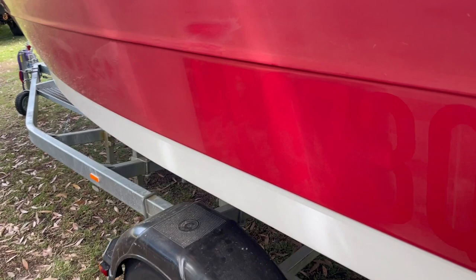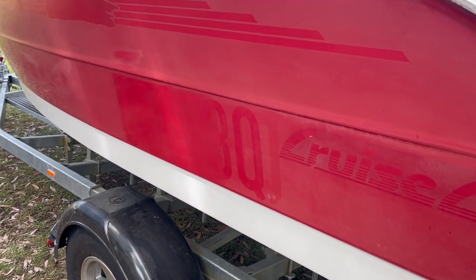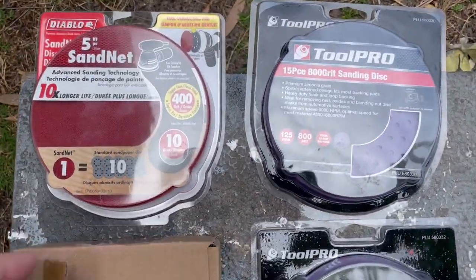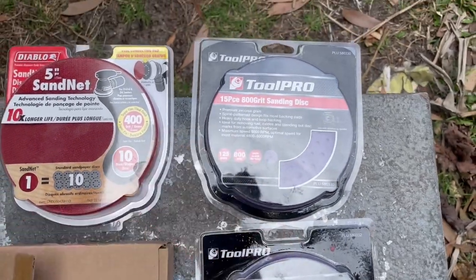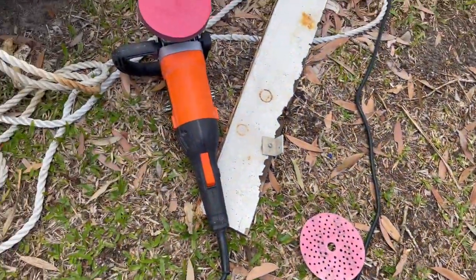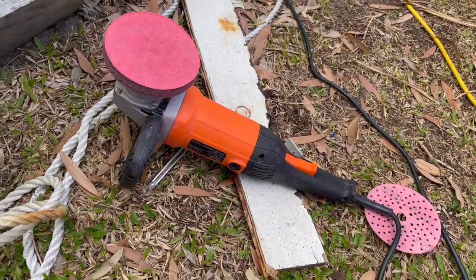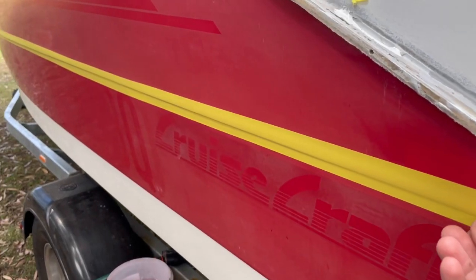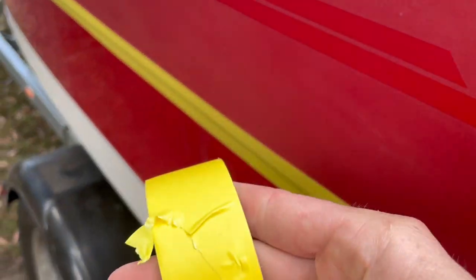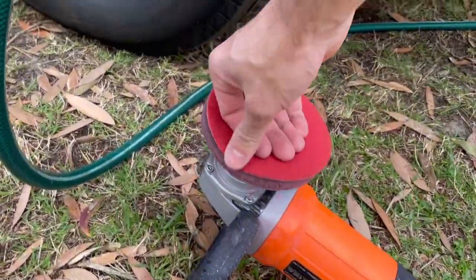I worked out we could do a fair bit more aggressive sanding without rubbing through — there's a small section on the other side I intentionally rubbed through just to see how far you could go, and it was very forgiving. I've added more tools: 400 and 800 grit for much quicker material removal. I also fried my little eBay sander so I bought a proper one. Any sort of ledge or lip you will burn through really quickly when wet sanding, so cover those up with plastic tape first. First up is 400 grit with a good backing pad.